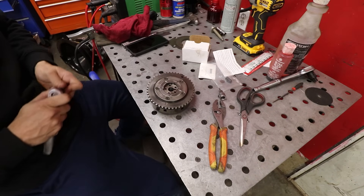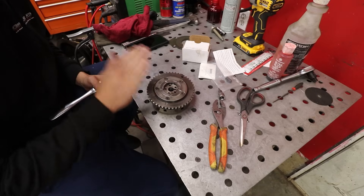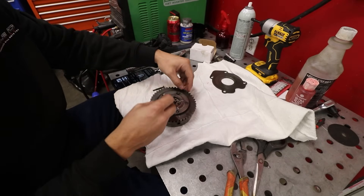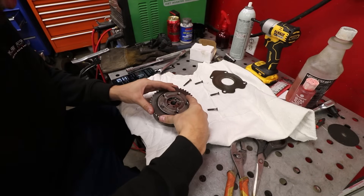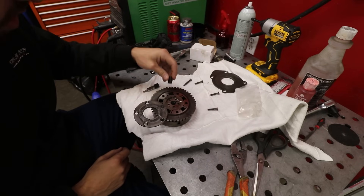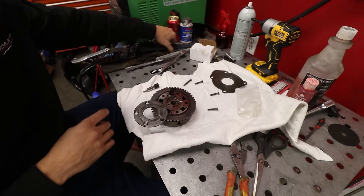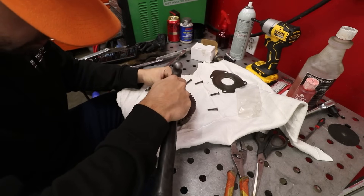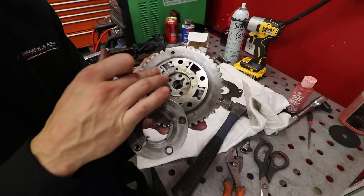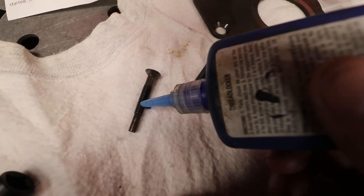This takes the tension off the spring. The bolt is the one directly under the cam keyway — you just crack it one turn loose, then all of these come out. There is one different length bolt so I'm putting them where they came out. Now this piece should just slide out of the way. It appears this pin just gets wedged in there and stops the phaser from rotating on the inside — a little bit of tapping.